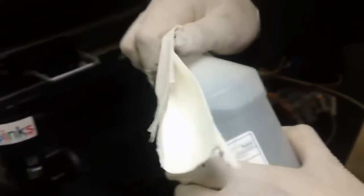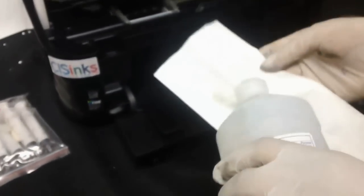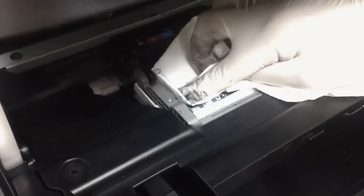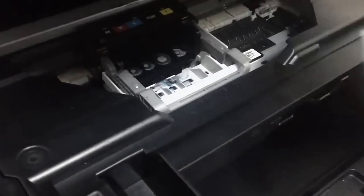You might want to clean the area before you move on — usually use alcohol and a wipe. There's a lot of ink in there, basically because we had a CIS system previously installed on this printer, so of course there are going to be some leaky parts.